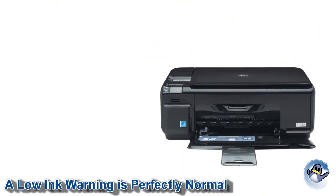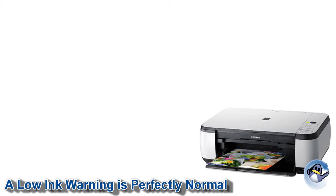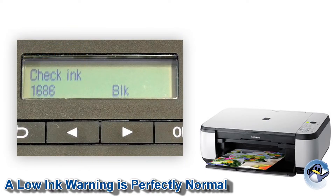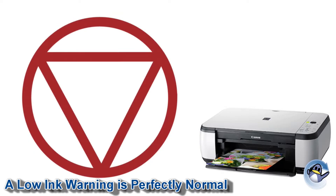With the majority of refilled cartridges the unit will still warn that it is low on ink. They should however not stop you from printing, and any warning can simply be ignored until the ink runs out again, with you having to give a small prompt to the printer at the very worst. Just be sure to read any messages given to you carefully, or look up any codes given to you by the printer, just to make sure nothing is being overlooked. Canon cartridges in particular require the press of a specific button.